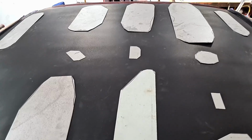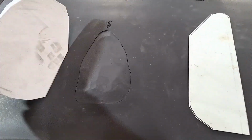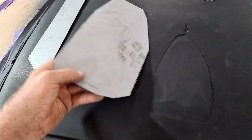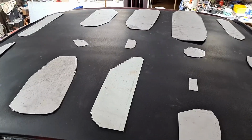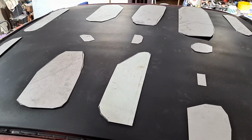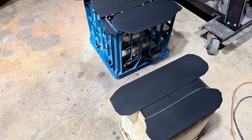I'll black the underside of all these patches, so it's sealed, although that's zinc anneal, so maybe it doesn't really need it. Anyway, I'll put some black etch on the underside of all those patches, start welding away. Hopefully we don't have a fire on the inside. Leave that with me. The underside of those patches are all done. Let's get to weld them on, eh?